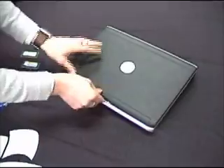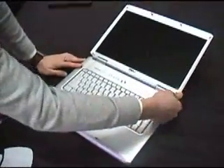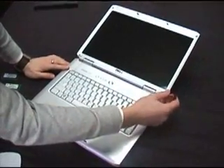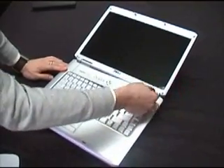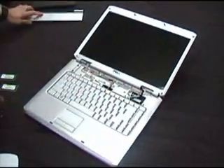First of all, we're going to upgrade the module beneath the keyboard. Lift up the lid and pull it back. If you look on the front of the laptop here, there's a slight notch. Slide your flat-head screwdriver underneath there and just gently tweak it away, and it'll pop.